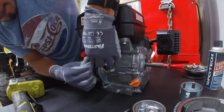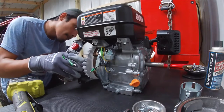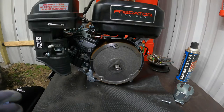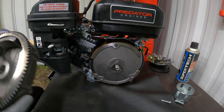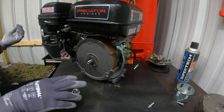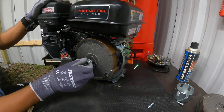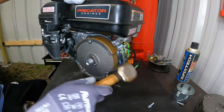With all that disconnected, we can go ahead and take off the kill switch and then take off the cover and the fan so we can access the flywheel. The next step is to take off the old flywheel, because the new one has magnets inside which charge the charging coil and generate electricity. We're going to put the nut back on so we can hit it and pop out the old flywheel.